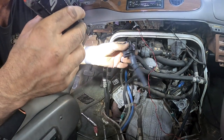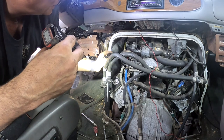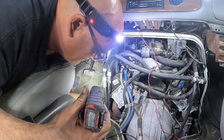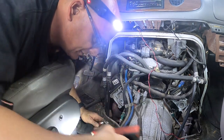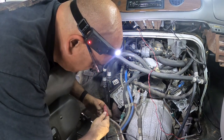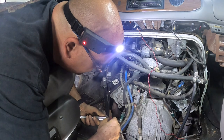The new coil pack is going to sit in there just like that. We're going to try to squeeze it back in - but it'd be nice to put the spark plug in first, wouldn't it? Got so excited I got ahead of myself. I'm going to use just a dab of blue Loctite on it.